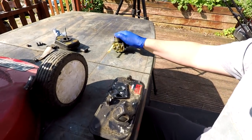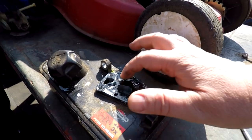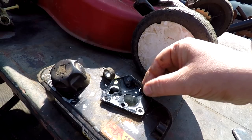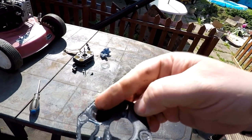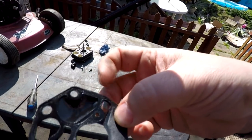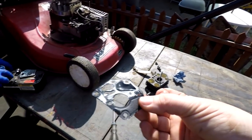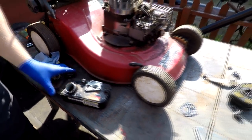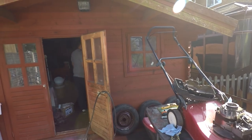Here we go with the carb diaphragm. Most of the problems we see with these is this little diaphragm - this one's got the telltale baggy gasket. These little flaps tend to wear and break over time, which causes the issue. You may not see a lot of problems here, but that bagginess in the centre diaphragm causes a problem, and so do these little flaps. This is what causes the hunting - the revving up and down. Lucky enough we've got a new kit to change that. The fuel tank looks okay and clean, and Gary is going to empty the petrol out just to make sure it's all clean in there and blow all the little jets and airways out.